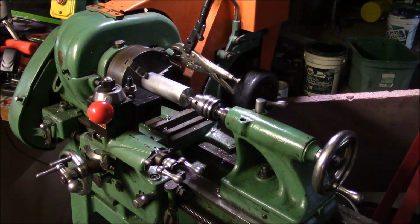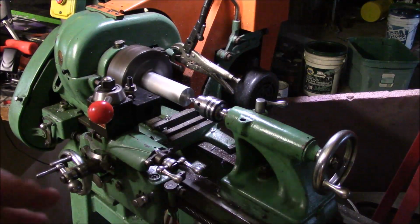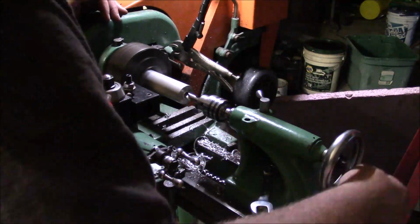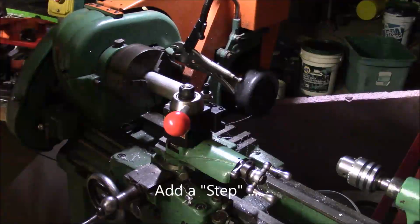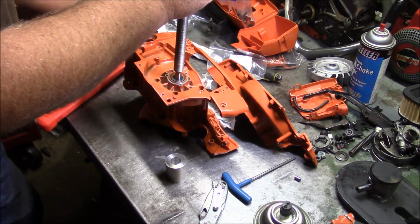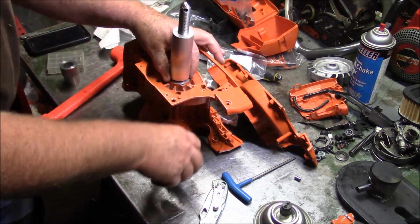Got another idea for a pusher for the 372 flywheel side. I think what I'm going to have it do is slide down a threaded rod in order to get it lined up. First thing I have to do is put a through hole in it. It's kind of a little hokey here, but let me see if it works. The idea is to let that center it some.